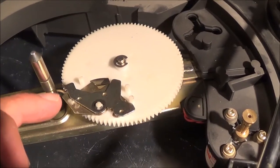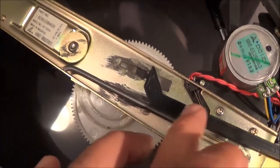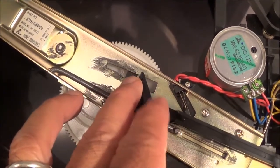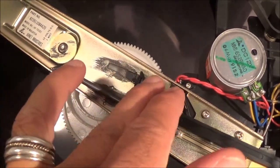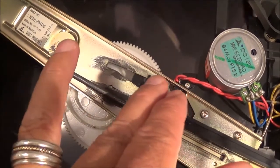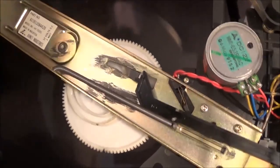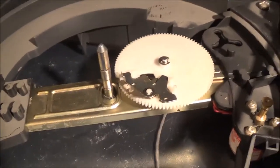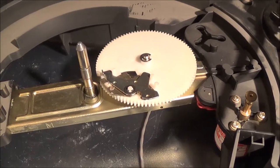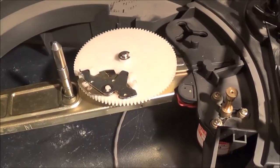To conclude, you can see there's some grease on here — this has to move freely. You can see that trip mechanism lever again; there's grease on here, you can just use light silicone grease. That's got to move freely too, otherwise you're going to have bindings and problems. I hope that wasn't too convoluted — I kind of explained it in a halfway okay manner.